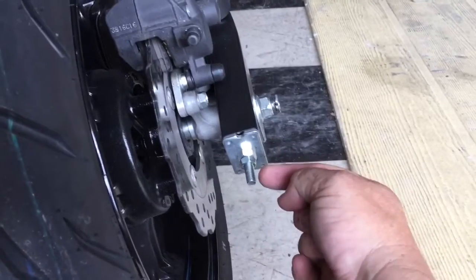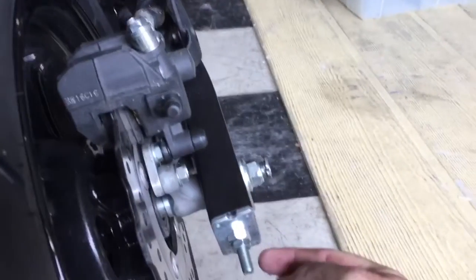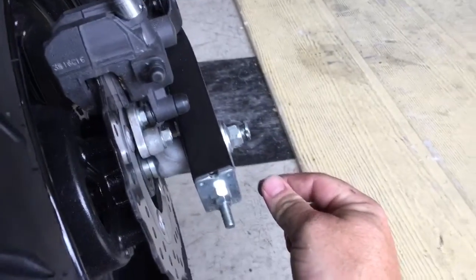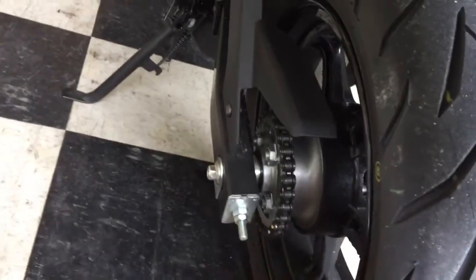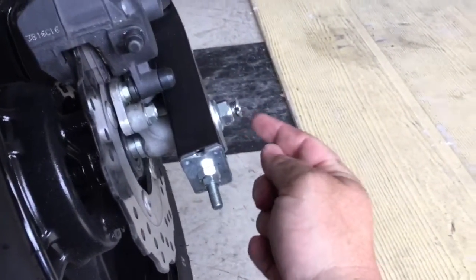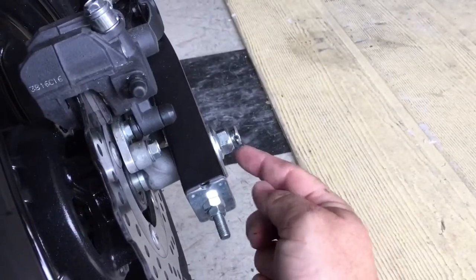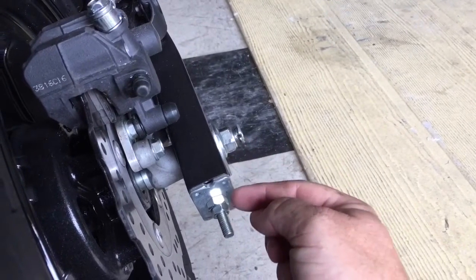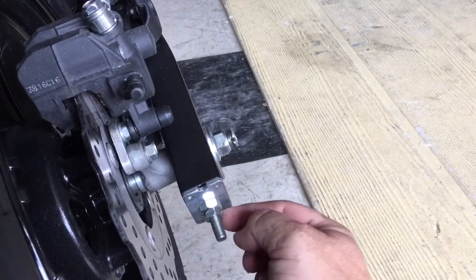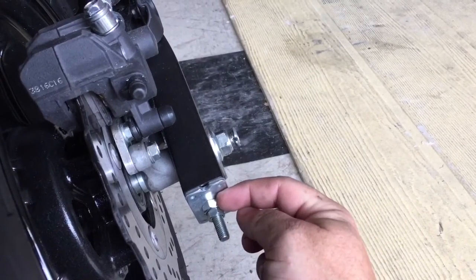Sorry, I've been drinking. You have one wrench over here, one wrench over here. Just loosen it up a decent amount. You don't even have to take that off — cotter pin. Thank you, you don't have to take it off, just loosen it. You loosen this outer bolt here on both sides. This is a 10mm and this inner one is a 14mm.